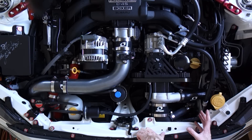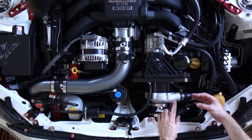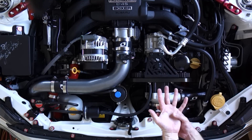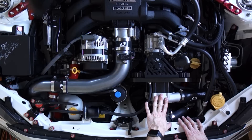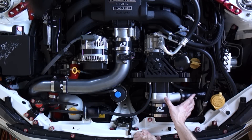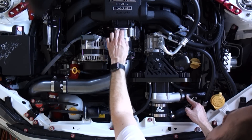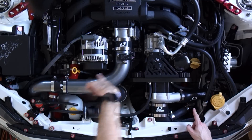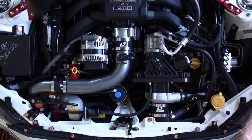The first scenario is when you get that compressor surge sound. Compressor surge is when the fins of the turbo or the fins of the supercharger are still spinning but the air is actually being forced back past the blades. Every time it passes a blade it makes a sound - that's what you hear as compressor surge. The other thing that can happen is you get the dose sound. Dosing is a mixture of a bit of compressor surge but also a pressure wave which is reverberating through your system between the butterfly valve and the compressor wheel. The length of the piping actually determines how long it is between the oscillations.